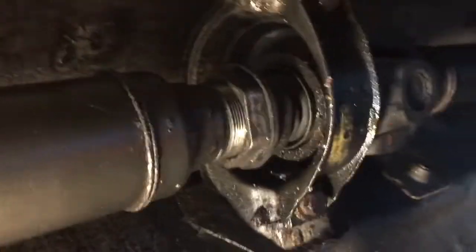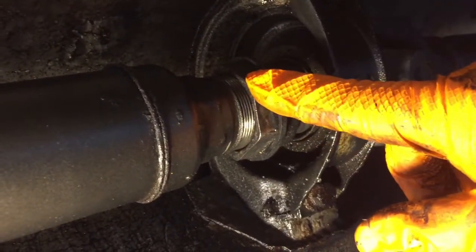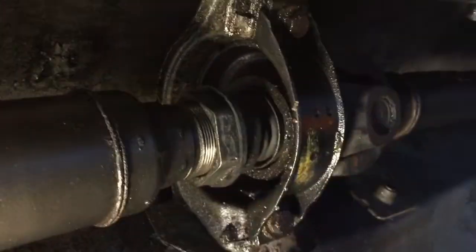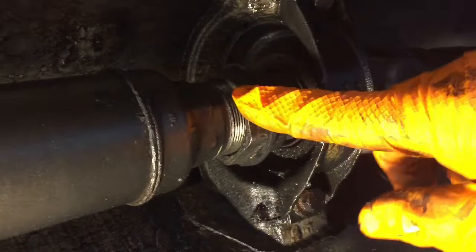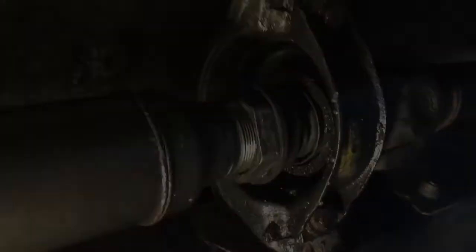Now I've got these nicely lined up. Don't forget when you have the tranny back in place, tighten everything up — tighten this one up last because you don't want it under stress, putting stress on the driveline. But also don't forget to tighten it up, because what is loose only gets looser along the way. Have fun.